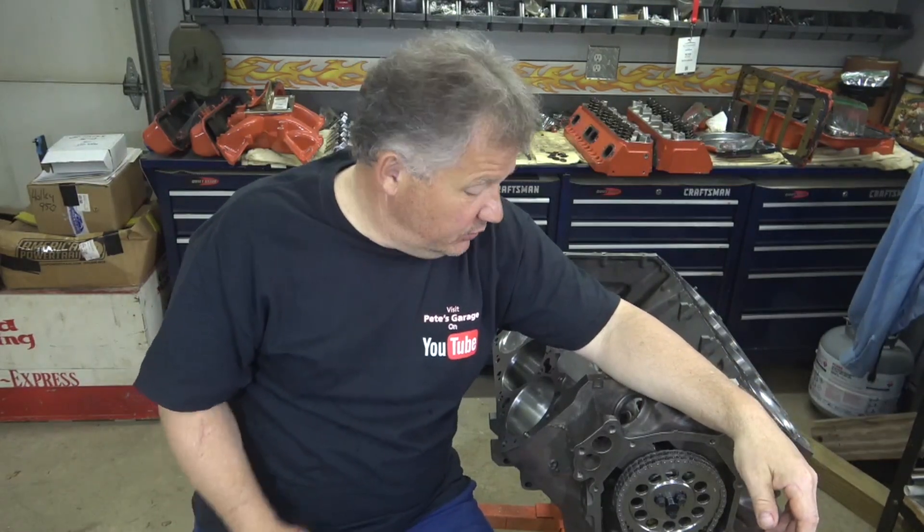So no problem reusing cam bearings if you have to — really no big deal. I had to use new ones since I have a new block. The timing chain is also no problem reusing as long as it's not worn out. You can tell by pushing on the timing chain — if there's too much slop in there you should replace it, but if you're on a budget you can reuse it too. My next video we're going to do the cylinder heads — we've got to change the springs to match the camshaft and account for the additional mass of the hydraulic roller lifters, which are heavier than the flat tappets that came out. I'll explain the difference, why the valve springs are being changed, and what the range usually is for roller springs with a roller cam. Hit like and subscribe to stay up on all the videos, and next video we'll be doing the valve train and cylinder heads. Thanks for stopping by Pete's Garage.